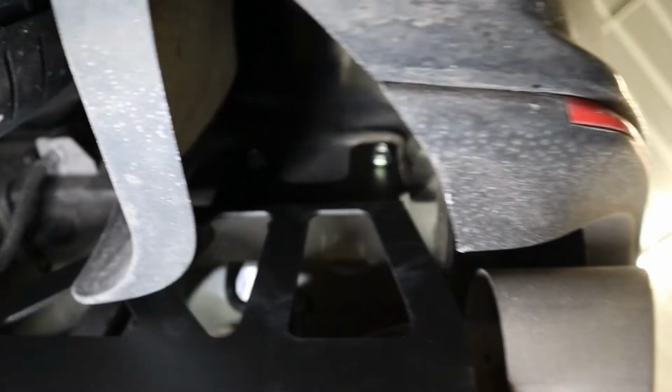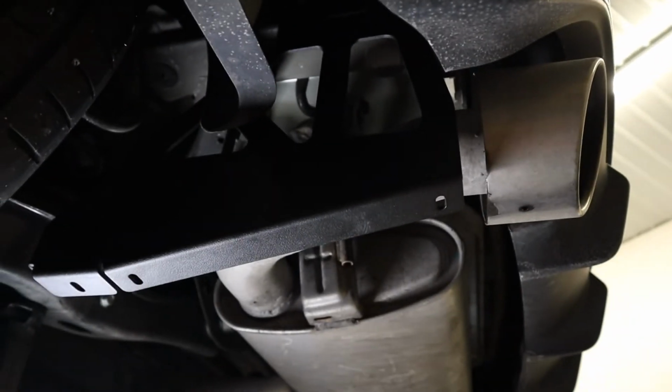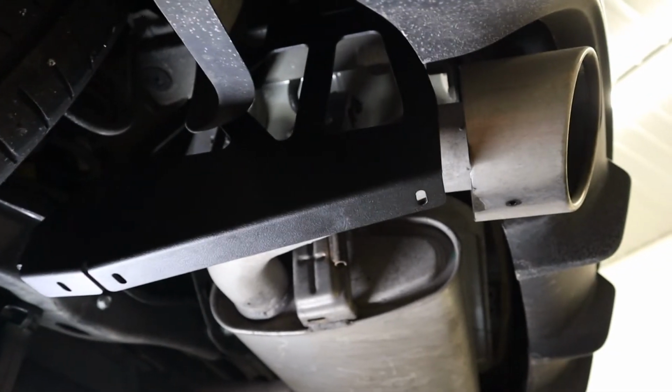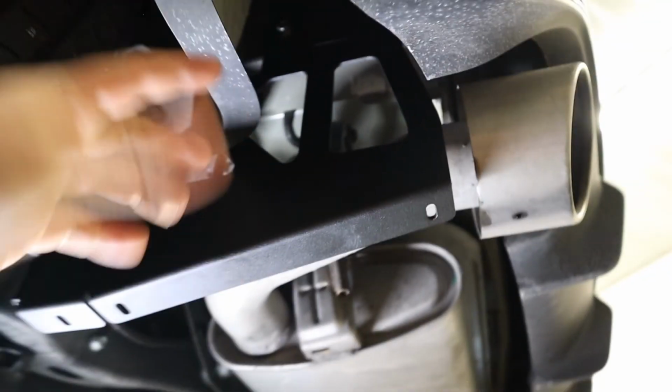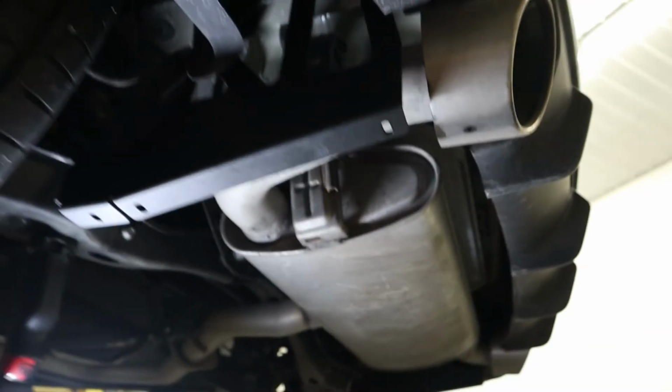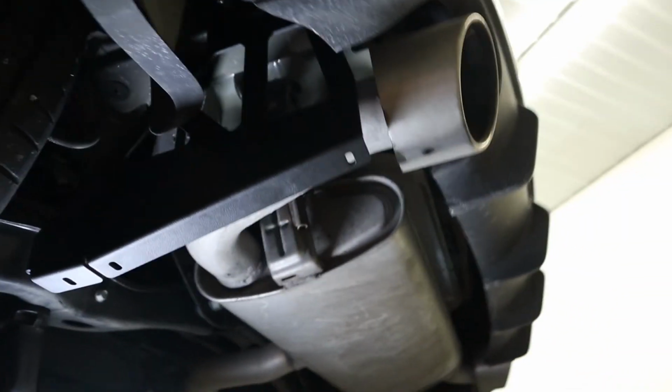And we generally recommend, if at all possible, to run the diffuser all the way up. So push the bracket all the way up and then tighten the bolts. If we have to, the good news is you can just loosen those M10s and we'll be able to drop the entire diffuser down. But for right this moment, we're gonna run it all the way up and move on to the rear bracket. You can follow me this way. That's where the rear bracket's gonna install. So we'll get to that real quick.